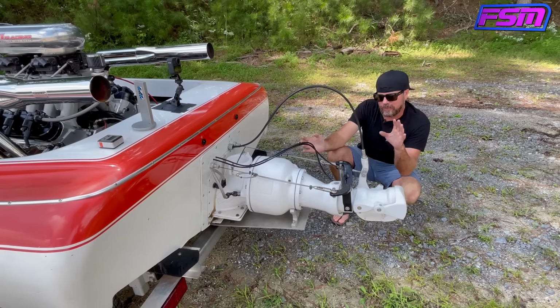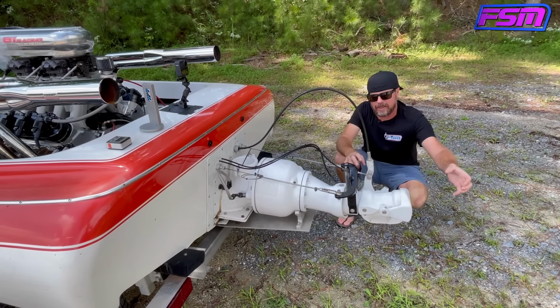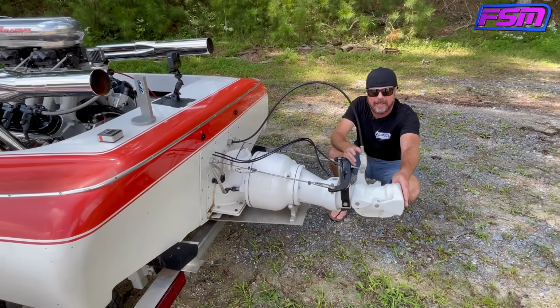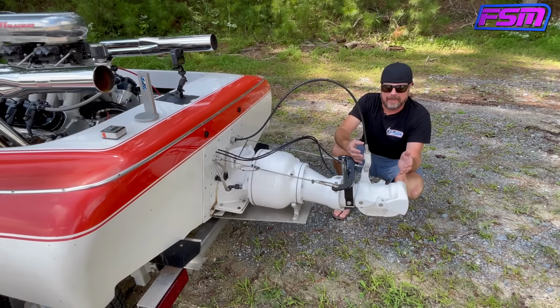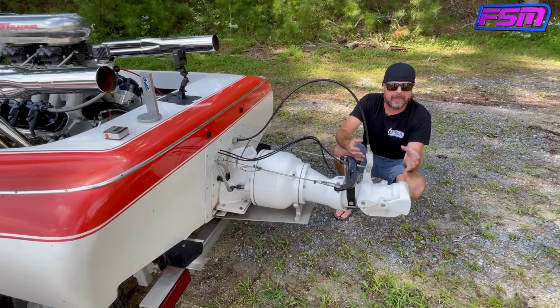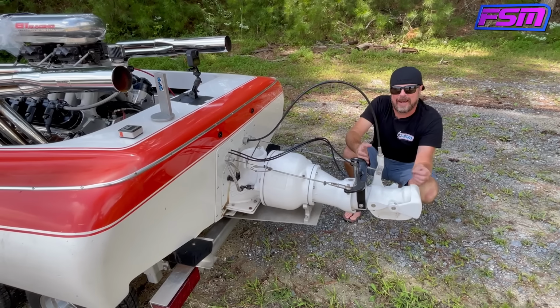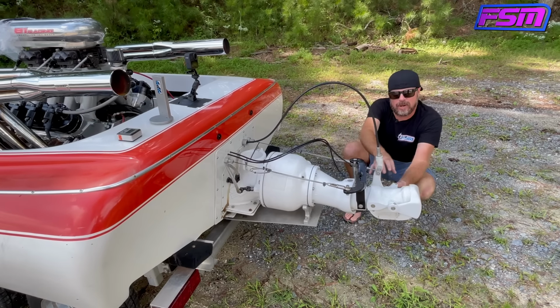However, you can't have thrust without suction, which is why I'm always like, it's kind of pulling itself through the water. And so the proof that the thrust is what's doing everything, and the nozzle reaction of the water coming out, is when, let's say on Game Over, we shut this right here and the water has nowhere to go but out the sides and the boat pretty much sits still. That's all the proof you really need to know that the thrust is what's propelling the boat. But even when I do that, that boat still tries to move, partly because water's leaking out in other areas, but also because I think there is suction there and it's kind of pulling the boat through the water.